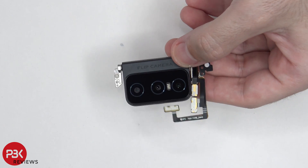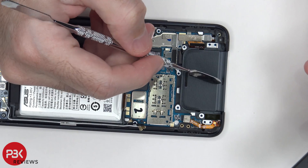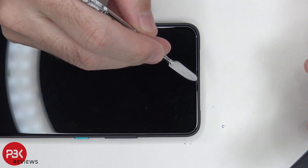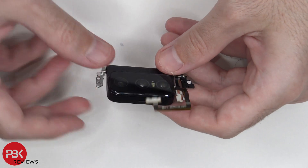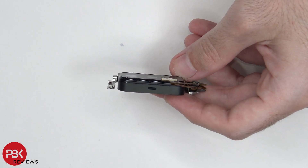The earpiece speaker is located inside this assembly, so the sound travels from that opening into this opening over here in the midframe. When you're on a phone call, the sound will come through the speaker grill over here. I'm not going to pry this camera assembly apart since I don't want to render it useless, but there's a seam or separation between the back and front piece, so you'd be able to pry those apart if you needed to gain access to the inside.